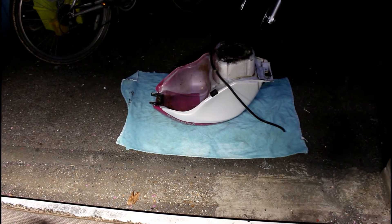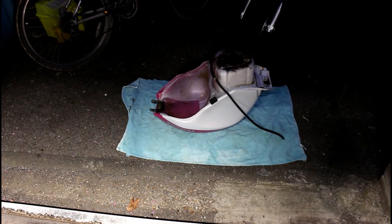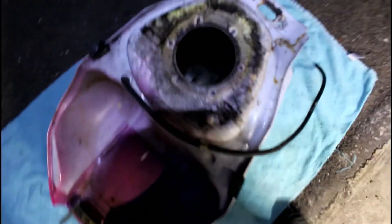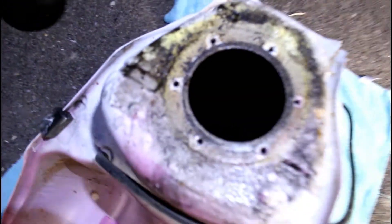Welcome back to Dino's Garage. This is after I've done the second dose of electrolysis using the sodium carbonate on the fuel tank to try and remove the rust. I'll show the inside of the tank after just flushing it out for the second time. Now, it's not perfect by a long shot, but there are visible signs of clear metal. Some of what you see down the bottom is loose residue and some of it is still rusted, but most of it has been removed.